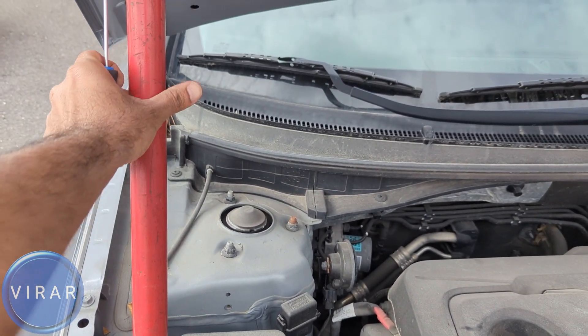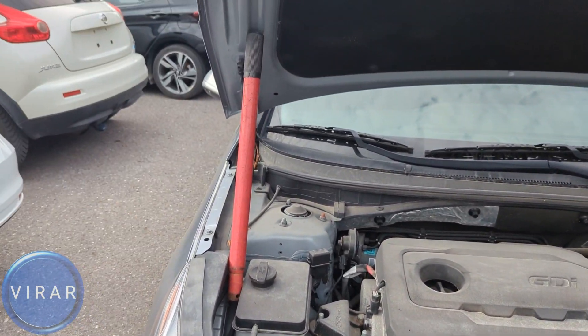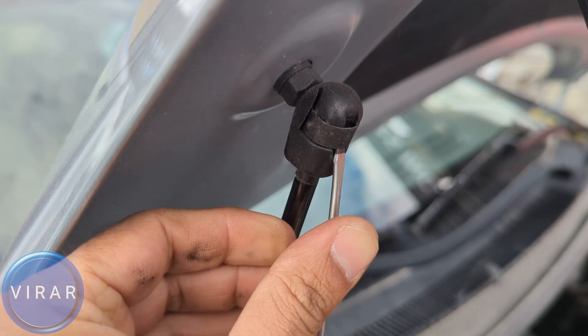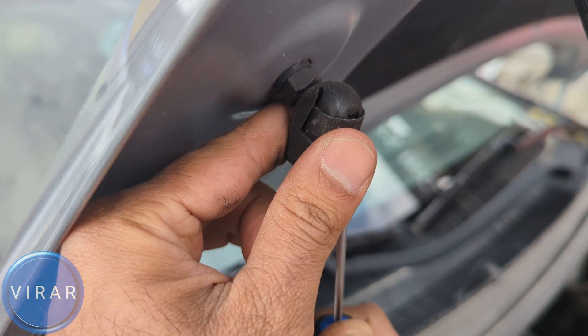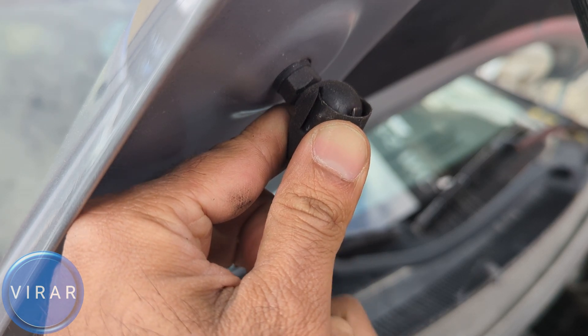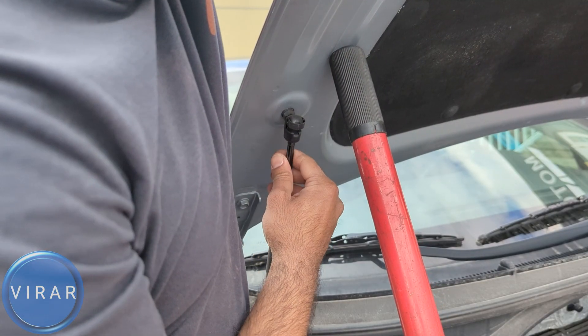Something that can support the hood when you take the one strut off. Because when you take one strut off, the hood doesn't stay in place by itself just on support of the other one — you need the rod. So get the screwdriver and now let's pry this clip out slowly. Be careful, this spring is under tension so you don't want it to fly off and don't get your finger stuck under there. Just do it the way I'm showing and gently get it out.